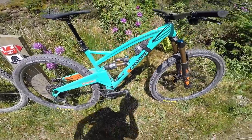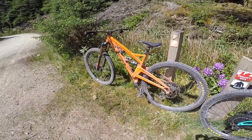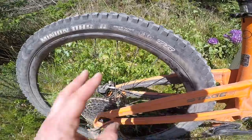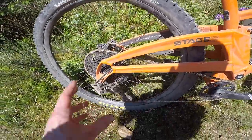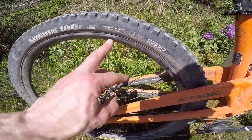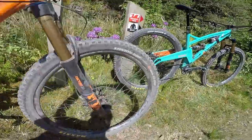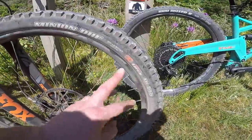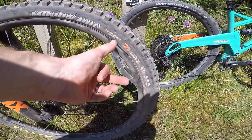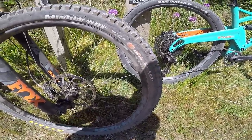You're probably looking around 14.2 to 14.5 overall weight without pedals. The other big difference — even though the rims are the same Race Face Arc 30, same Eagle X01 setup, same Hope hubs — you've got a Minion DHR2 on the rear with a 2.4 inch wide tyre carcass, a bigger volume tyre. Up front you've got Minion DHF in the 3C Max Terra compound — that's the triple compound — and it's a 29 by 2.5 wide tyre, so more volume and more grip.